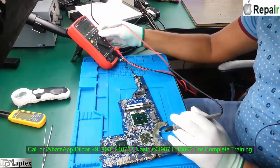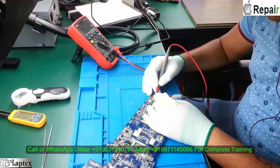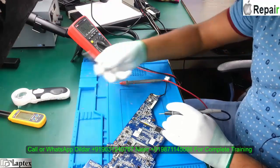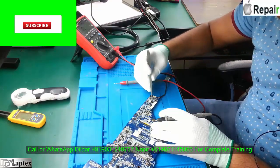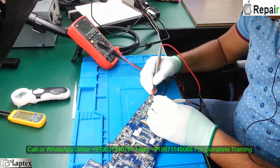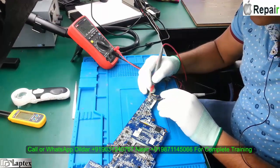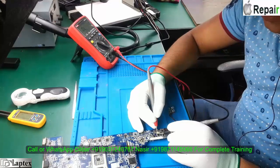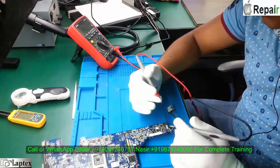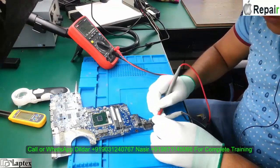In these types of cases, it's not necessary that all the time the signal and the voltages could be the fault. So let's check for shorting. First, in the DC-in area, you have to check the mosfets. Let me discharge it first. Now what you have to check in the mosfet is source to drain, source to gate, and gate to drain — all three pins must not be short together. There must be some certain value of diode, as there is an inbuilt diode.